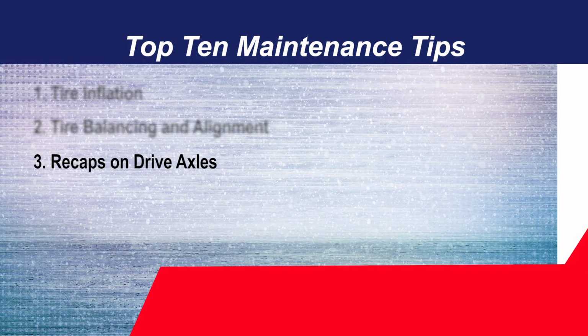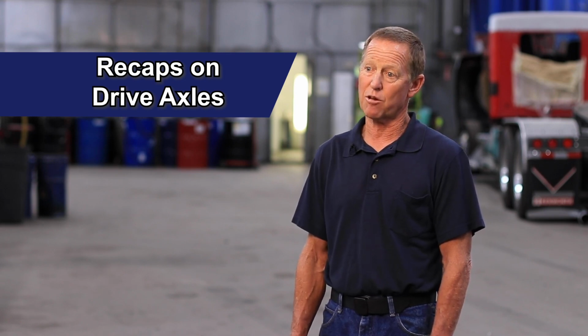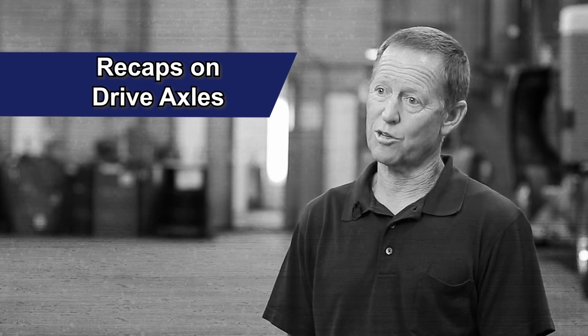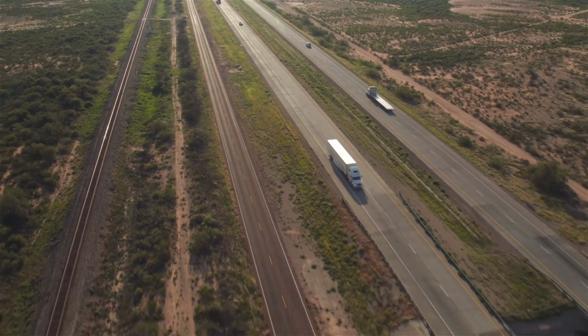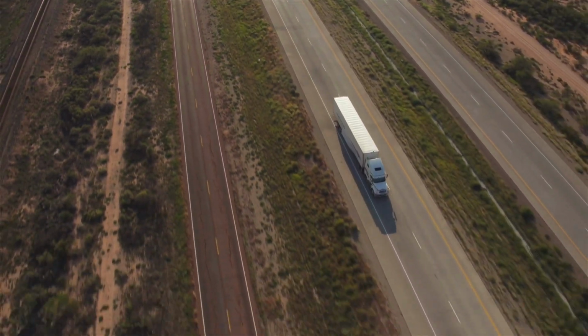A lot of guys will run caps on the drive axles, but on some of the smaller tires, on these specialized trailers, they can't run that big a tire. So they're always putting new on there because they really heat, because they're running a lot faster in a mile. They're spinning, sometimes 600 revolutions a minute, where some of them are spinning like 400. So not as much, they don't get as hot, but they're still running the same amount of weight. So that little tire, they usually put brand new on that.